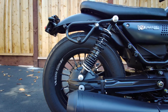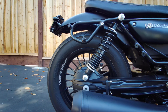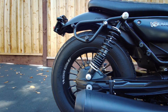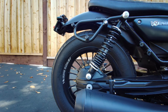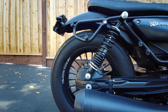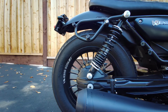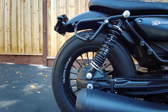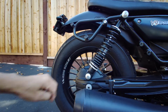So basically, the difference between 325 and 350 is 25 millimeters, and 25 millimeters is 30% of 85 millimeters. If you put 25 over 85, you basically get 30%. Approximately, it's actually 25.5 millimeters, but let's call it 25. So yeah, I got that. Now I'm actually done setting the preload, and I should be good.